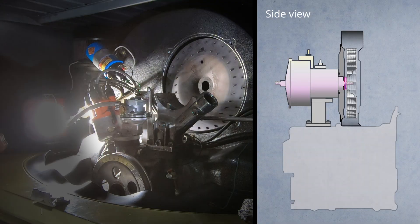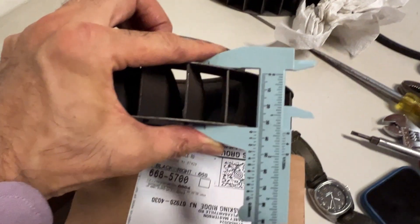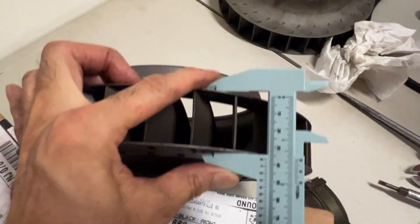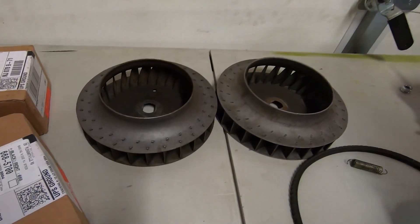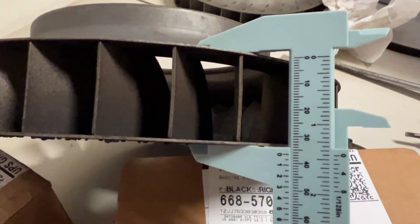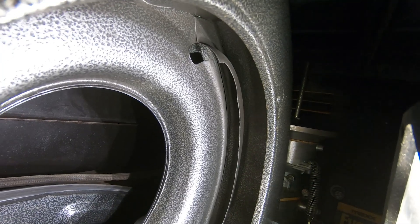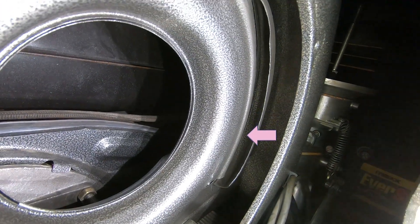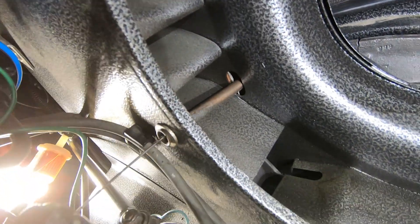When we pull the alternator out and separate the fan and the alternator, we need to be careful not to drop any shims placed between the alternator and the fan. Shims are used if the fan touches the plate, but in my case there were none. I checked the fan size — because my engine gets hot often, I wanted to make sure the right size fan was used. I compared the fan with what Casey had. They are the same size, and the depth of the fan was 35mm, which should be the right one for the shroud with doghouse oil cooler. The fan has to be wide enough to blow air into the slot connected to the oil cooler. While the fan was out, I checked the fins inside of this aftermarket shroud.